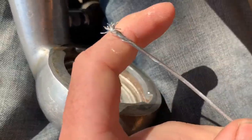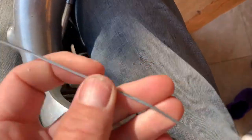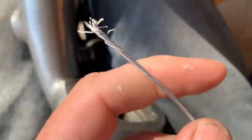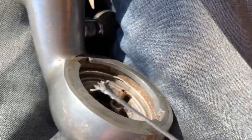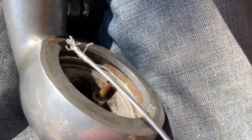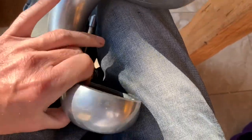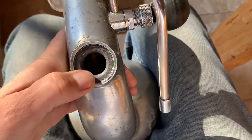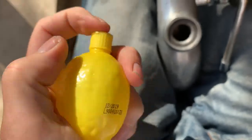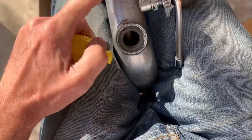The curtain track did clear some of the blockage, but I couldn't get all the way through. While I was at Wilco's, I also bought some brake cable. It's flexible but doesn't completely bend, and when you cut the end you get a frayed bit that actually works really well as a kind of drill bit. When I put that down the tube and attached it to the drill, it cleared the blockage almost straight away. Now I need to fill this up with water several times, give it a good shake, pour out all the residue, and also pour in lemon juice - being careful not to get it on the shiny side of the atomic - and leave it to dissolve some of the limescale.